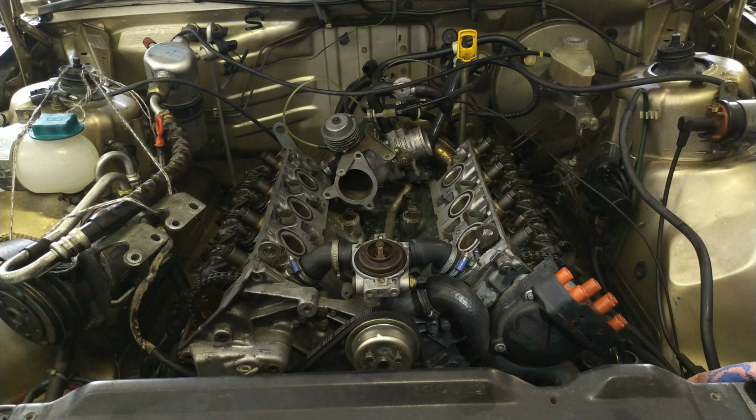This motor has a timing chain which will last, to our experience, at least 200,000 miles. It always depends on regular oil changes, of course. These engines are extremely robust, but mind you, that's only the B280E or F variant. The smaller, older variants, B28 and B27, are prone to failure if they're not meticulously looked after.